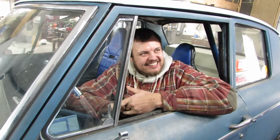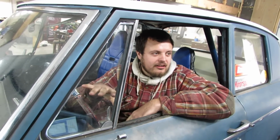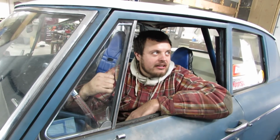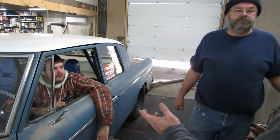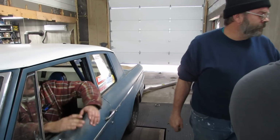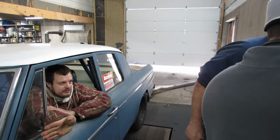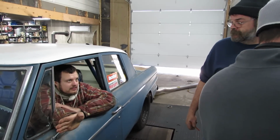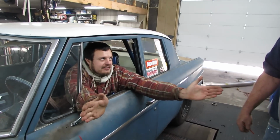It needs more angle. We know that. And because the other thing is, I can command this thing to just testing. I could command it to 33, but honestly, that doesn't make any difference. It's just like ignition timing. You just pour it in there, quit making power. I don't care what angle it's saying. I know that physically that thing can't move more than 25 degrees. But it's giving me a range of -4 to 33 in here.